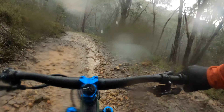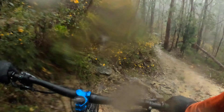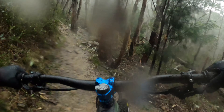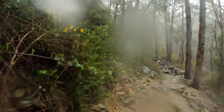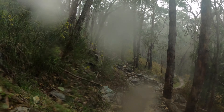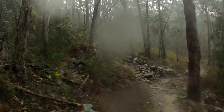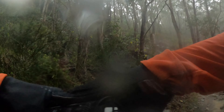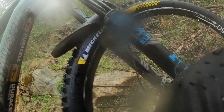There's so much water in my eyes, can't really see what I'm doing. Getting darted around a little bit, punched off things. Terrible line. Maybe high on pressure to start — I've got 23 in the front, 26 in the back. On a 29er e-bike I usually run 22 front, 25 rear on a normal bike with normal tires, but these things feel really stout and really choppy, so let's go down a full PSI at least.